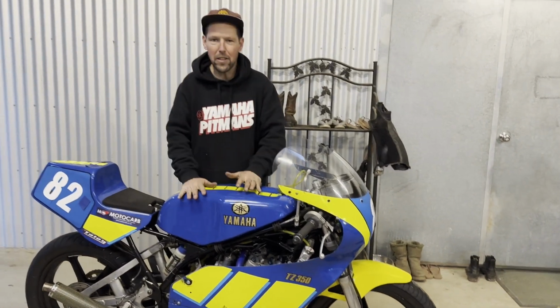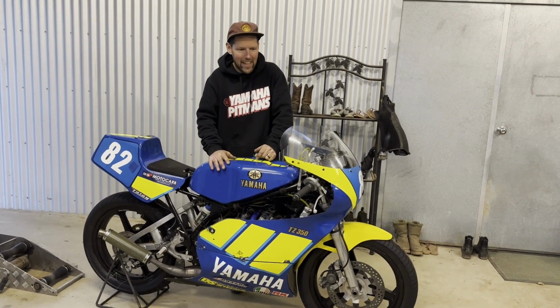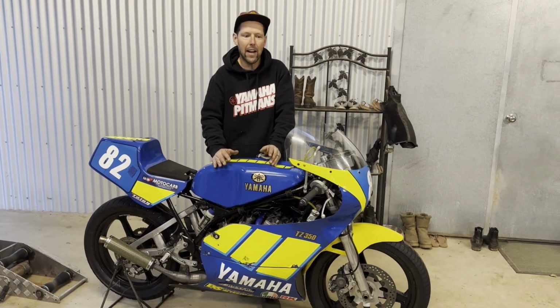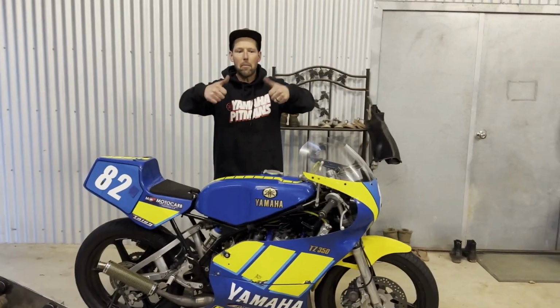It was a little bit different this one. No riding, I just wanted to show you guys a bit of the stuff I do in the sheds with Dad and the workshop. So in my last episode, I asked you guys to leave some comments on the video, and I had Alan Rodriguez comment about some TZ tips, and he recommended to have warm-up spark plugs. And so we actually do that, Alan. I didn't do it in that last video, but we normally run like an 8 heat range spark plug for warm up and then run 9s or 10 heat range when we race. So really appreciate the comment, mate.